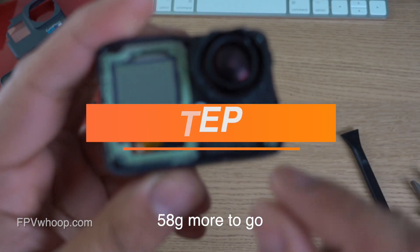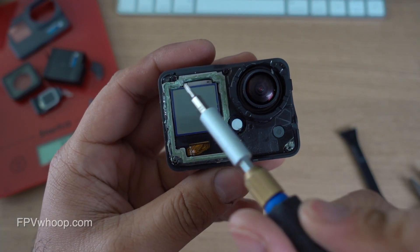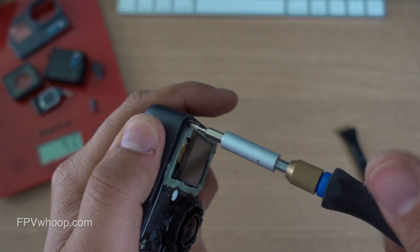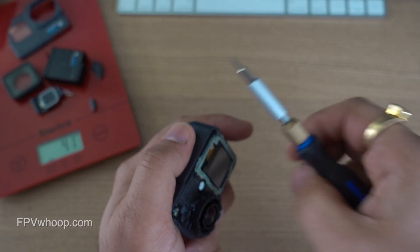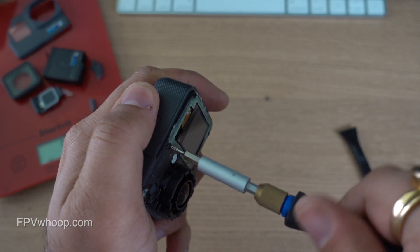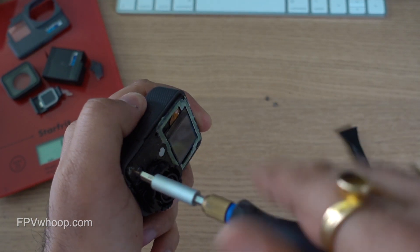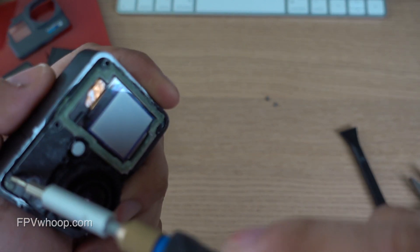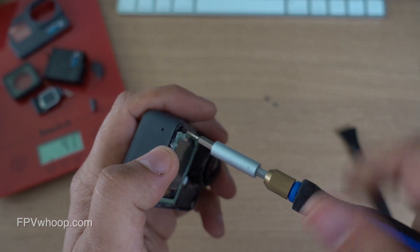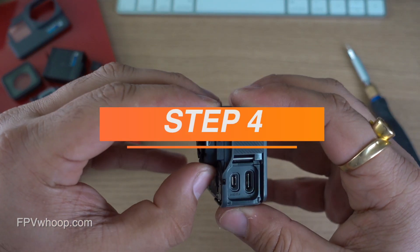Now is the time for step three: we're going to remove the six front screws and then remove the front metal plate. I'll keep those screws somewhere safe so they can be used later — maybe to mount back or on a TPU print. Once I remove the six screws, I can easily remove the front metal plate which is attached to the motherboard, and then also remove the back housing which holds the battery.